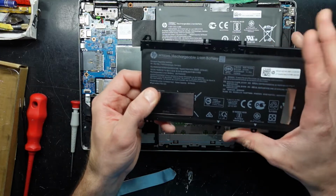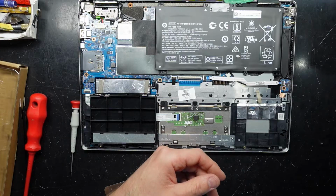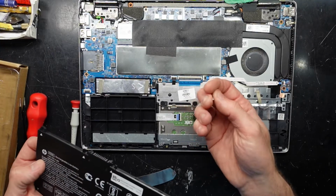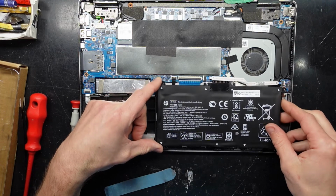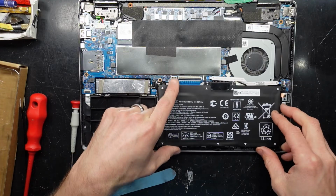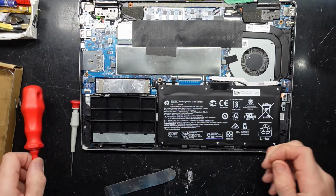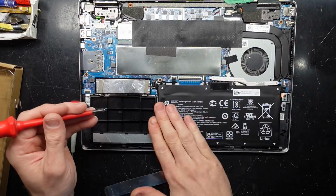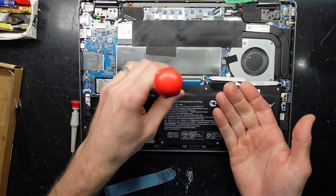This is proving to be very challenging. What I'm going to do is throw this on a heat pad, heat it up to 70 degrees, or at least those metal bits up to 70 degrees, and go from there. Do have 1 broken tab here, not sure where that's from, but it's no longer needed. From here, line up the battery, these 2 bits here and here, line it up, push down, and we're in. Then from here, put those screws back in once more. You can just feel that, just by feeling that, it's definitely considerably flatter than what that other battery is.